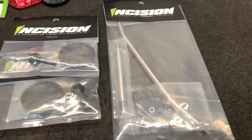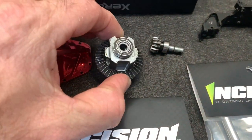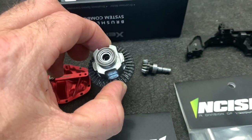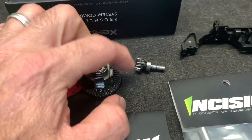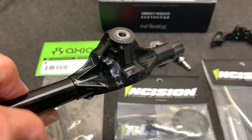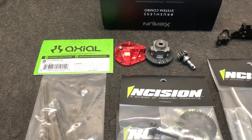We're going to see how it works out. I'm just simply going to put the new ring gear on, take the four bolts and the bearing loose, bolt the new ring gear on - simple and easy. Obviously change out the pinion. If there are any bearings anywhere that need to be changed out, hopefully I have them in stock so I can replace those as well.